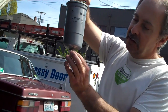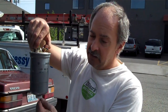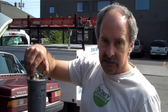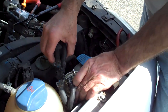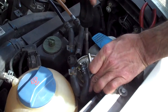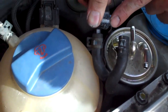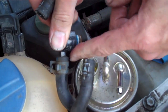What we do is we drain the filter into a clean container so you can see what comes out of it. That way you can tell what's in the tank. So this is a good filter — we're going to put it back in. Get it positioned fairly correctly. See if the hose is pointing in the right direction. Retighten the clamp. And then on the fuel return thermostat, there are some O-rings here. You should always replace those O-rings when you change the filter.